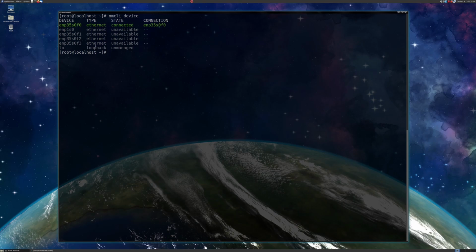network interfaces. Remember, I put in a quad port Intel 1 gigabit NIC in order to overcome the installation problem, where it was not recognizing the Aquantia 10 gig network port, the one that's onboard in the P620. Well, apparently after the installation completed, it has no problems with it. So I don't really understand what that's about.